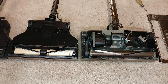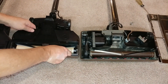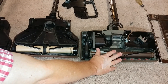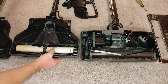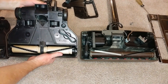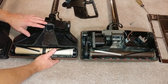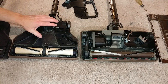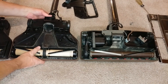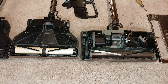Moving forward to 1997, let's take a look at my PE nozzle. Pop the plate off and you can see the difference — obviously between brush roll, beater bar, brush roll. It's got these little leading edge things right here, or trailing edge since it travels that way. It has the same kind of U-joint and an awful lot of airflow loss. Hooked up to my 1997 D4C SE, we're talking 33 nozzle CFM with the brush roll spinning. This one is a PN2.